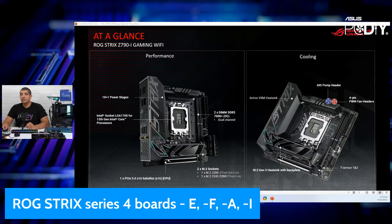You'll see in terms of the M.2 and PCIe specification support, you have dual Gen 5 support. So Gen 5 on the primary x16 slot, and then you're also going to have Gen 5 on the M.2. You're going to have two M.2 slots on this motherboard. So this is a little bit different from the prior generation where we had kind of a tiered specialized design, which gave you some cool flexibility, but to maximize interoperability and compatibility, we've gone ahead and made some design revisions for this generation. So we've tried to give you the most space for those of you that want to run tower coolers, but still also give you the flexibility to have two M.2 based SSDs, right?